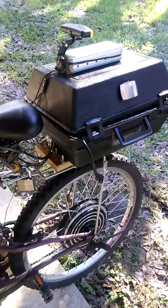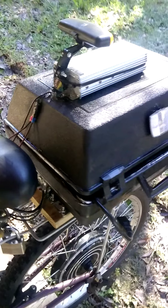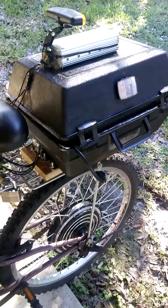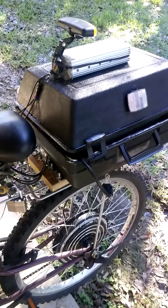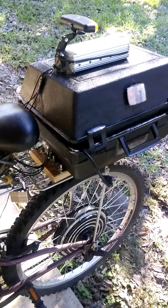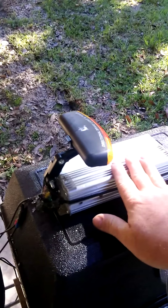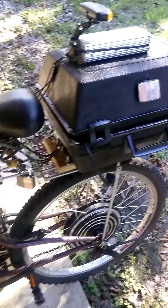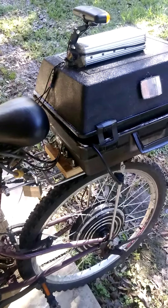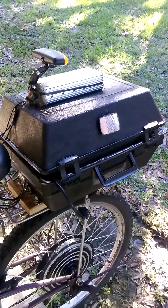That bike is also going to get a body. At some point I'm going to swap out these old lead acid batteries — what's going in there instead is a heavy-duty lithium polymer battery pack built from 18650 cells. It'll be a 48-volt pack, somewhere in the 24 to 30-something amp hour range. I can't go over 1000 watts because the controller is rated at 48 volts, 1000 watts.